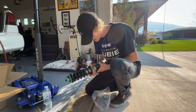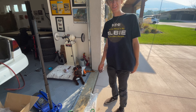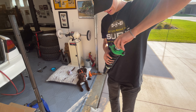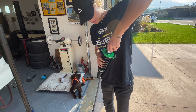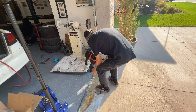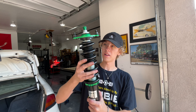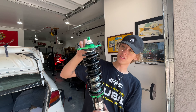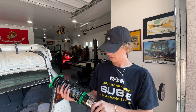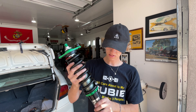Okay, that's maxed out now. We've got to loosen that and bring this all the way down — we don't need preload. We're going to go all the way hard on the dampening. Look at this — you spin it all the way down, the spring sits free, which gives you however much more clearance that is until this hits. This will be fine because as soon as the car's on the ground it'll compress and everything will touch. So this isn't that sketchy.